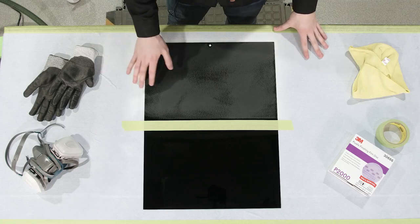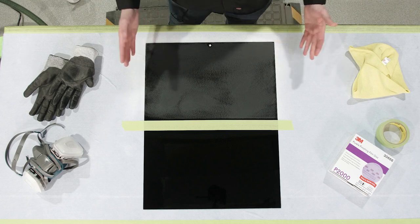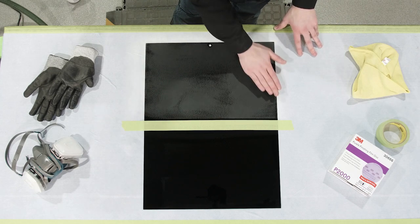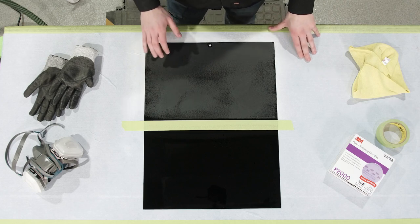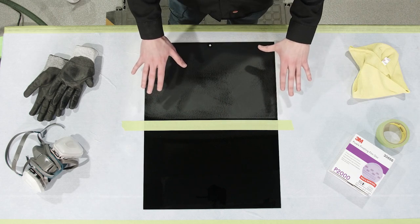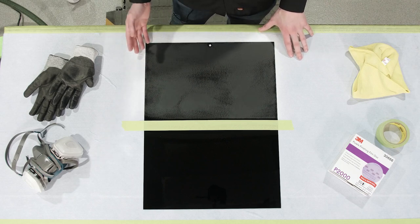As you can see, I started off with my 2000 grit and really highlighted the entire area. I knew there were a lot of dirt nibs in the surface, so that was a way for me to visually see where those defects were and what areas of the panel I needed to focus on. Once I highlighted where the defects were, I tilted my DA up on an edge and really just focused on that small area. I didn't want to sand too much because I didn't want to remove any of that texture. You can see there are a couple small flat spots — I tried to blend that into the rest of the area so we're not removing too much texture. There's not much visual indication from where the defect was to the rest of the panel.